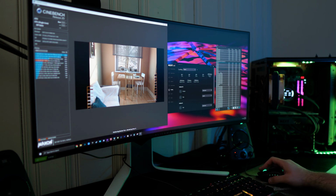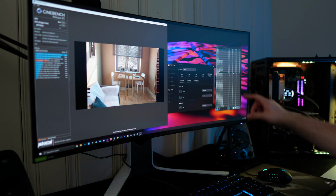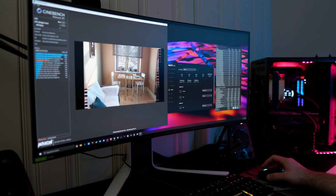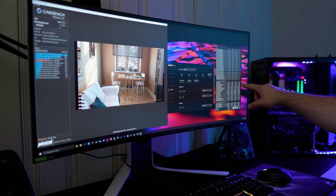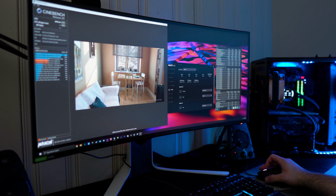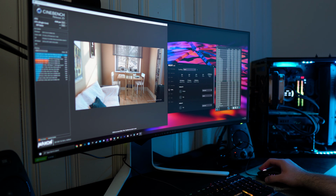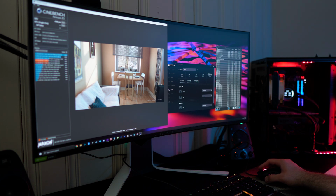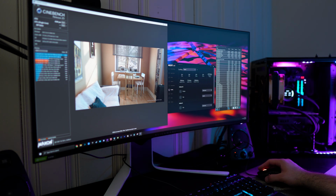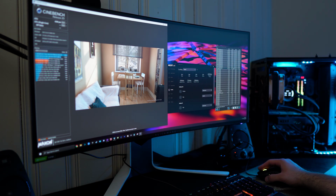And if I come over here, utilization, let's see. Thermal throttling, no. Power limit exceeded, no. CPU package max, 69C. Okay. All right, so 5.2 gigahertz. It's showing a max of 1.315 volts. I don't think that this is accurate inside of HWiNFO as far as the voltage is concerned. It could be. I just don't think it is, considering I set a manual voltage inside the BIOS.